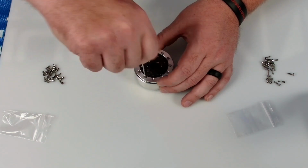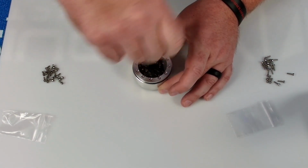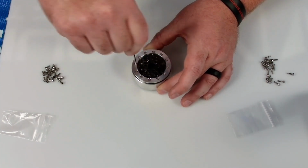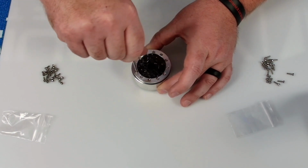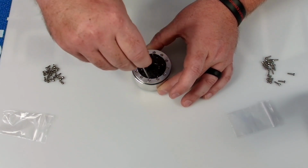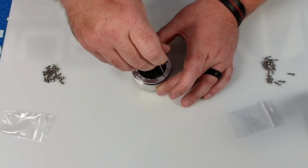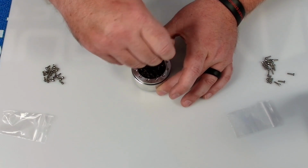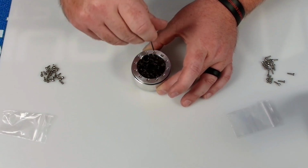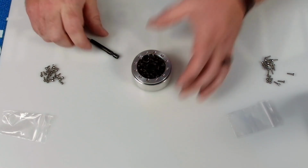all the screws down. So now once you've got that, you're able to go around and do the ones that are just holding the carbon on, then just holding the beadlock ring into place. Obviously you want to go all the way around different ways or in a pattern, but you guys get the idea. And there you go.